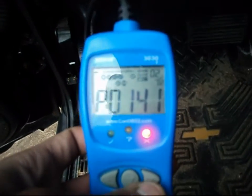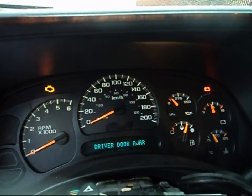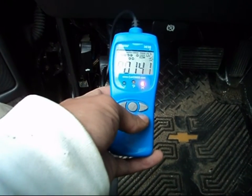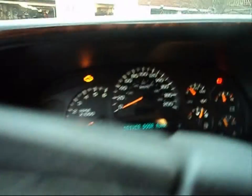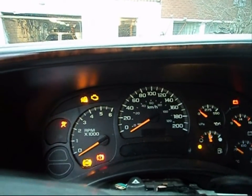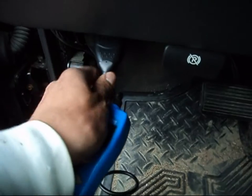Your mechanic at your local garage would come out and tell you your oxygen sensor is done — bank one sensor two is at fault — that's why your service engine soon light is on. Then he'd send you a bill. And before he unplugs the diagnostic outfit, he is going to more than likely erase the code. So I'm going to go ahead and hit erase the code, start the truck, and the service engine soon light goes out.